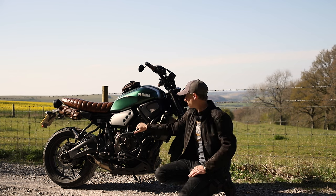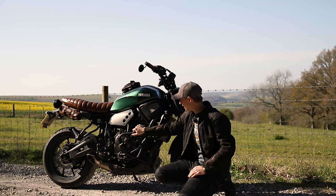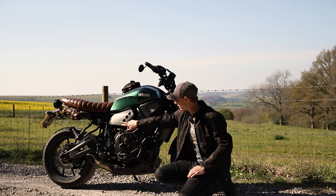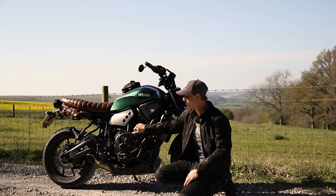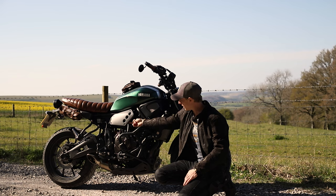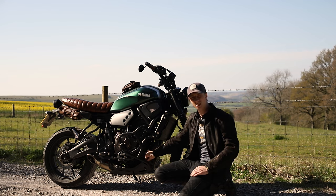One place the bike needs a slight modification: this side cover here just clashes with the bar a little bit. I've actually left a screw out — probably not the best idea and I will fix it eventually. The fix is just to take off this silver side cover and file a little bit away off the back where it touches, and that's that.